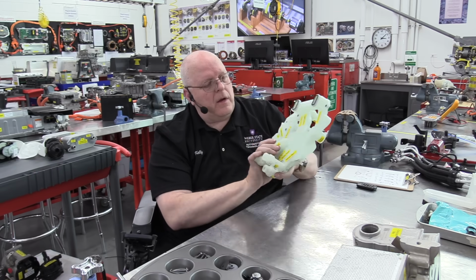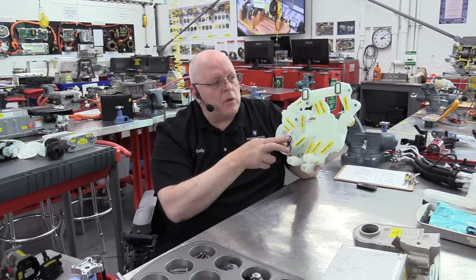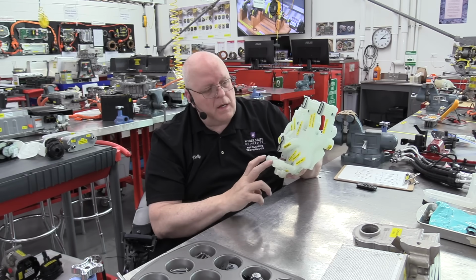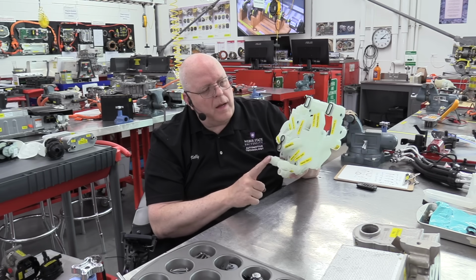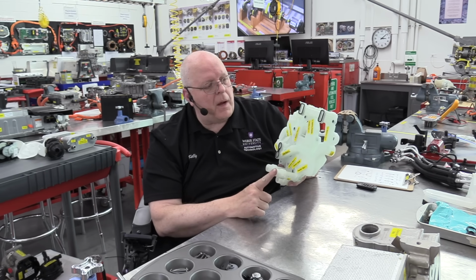And then on the front here, we have the coolant connections to the chiller, coolant connections to the liquid cooled condenser, and then 3 more coolant connections, one to the radiator down the bottom center here, one from the radiator, and one from the high voltage powertrain.